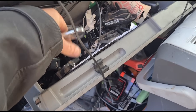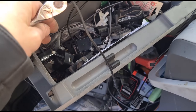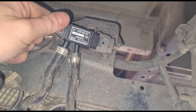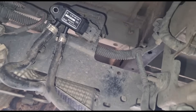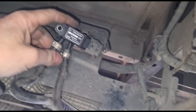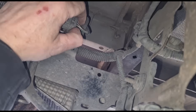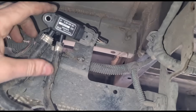I do carry some DPF pressure sensors in here, so I'm going to have a look through and see what I've got that'll fit. I've got this sensor off and another one from the van here. We're just going to temporarily place it and have a look at the live data. If this doesn't work we'll check the circuit wiring, but I doubt that's an issue because it all looks okay - I think someone's just put a dodgy sensor on here.